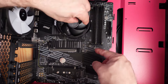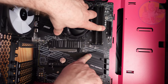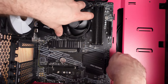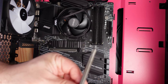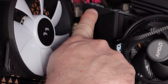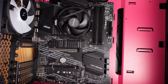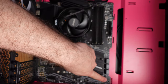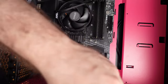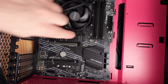Make sure all the screw holes are perfectly lined up. The reverse standoff is very important because it sticks out, letting us know we at least have that one correct. Then move the board diagonally to check alignment. Using a magnetic-tip screwdriver, place a screw at the very top and screw it in 100%. With that one in, line up the rest of the board and fill in all the remaining screws.